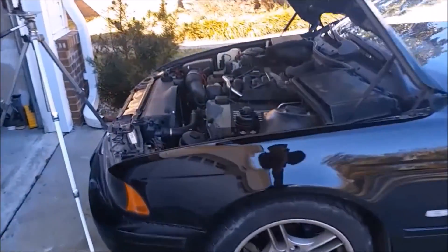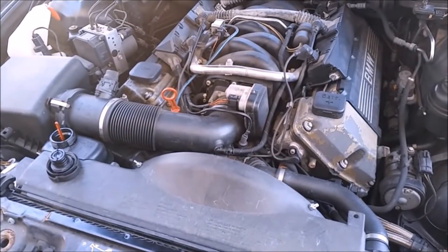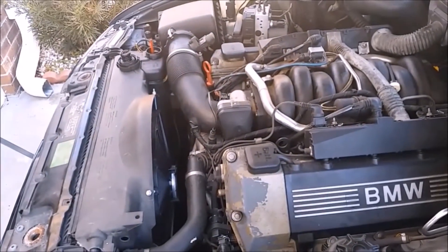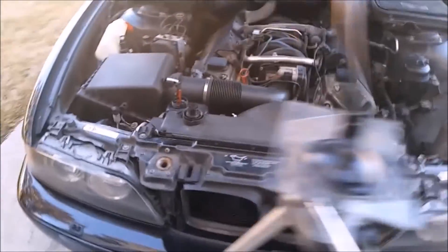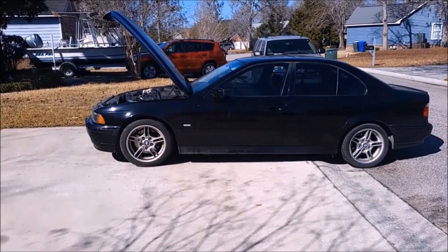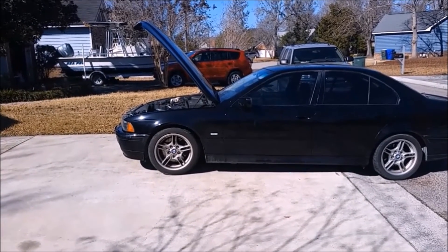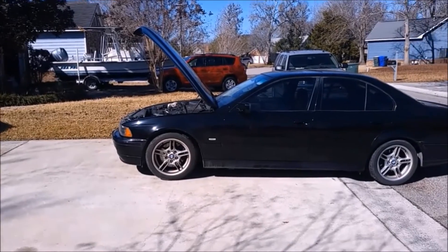She's still doing good. We're getting close to where the thermostat should open. I've got the heater turned all the way up just to get everything out — we didn't lose that much coolant, but better to be safe than on the side of the road calling Uber. Now the front of the car is much higher than the back — it's got a good maybe six or seven inches of tilt — and that should help get all that air into the front of the coolant system.